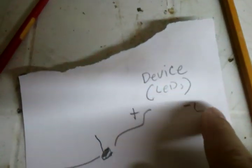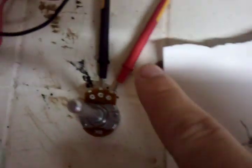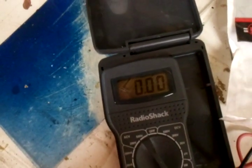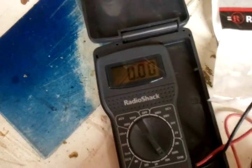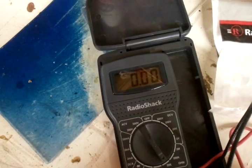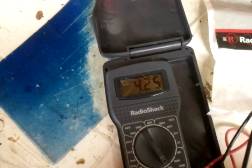So what you want to do: hook your LEDs' negative to the chassis, the positive to one of the two blades on the potentiometer, and then from the battery to the other blade on the potentiometer. This will run the line at zero ohms of resistance, which means a full 12 volts of power is going to your LEDs. As you turn it up, the power to the LEDs is going to go down, because it's adding resistance to the line.